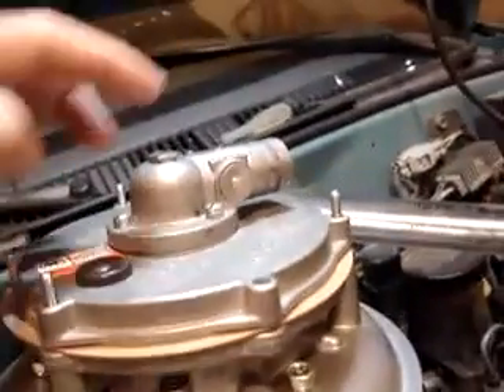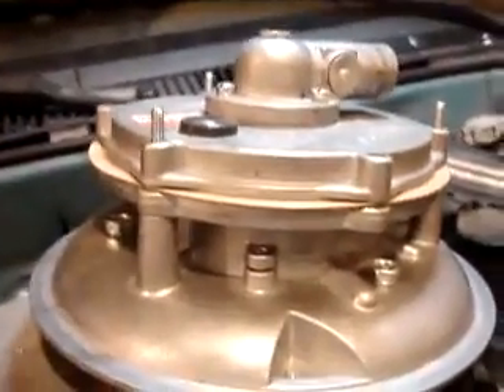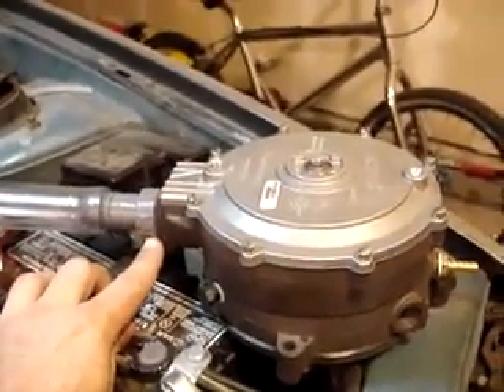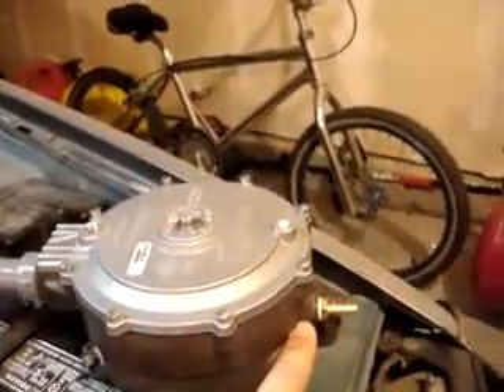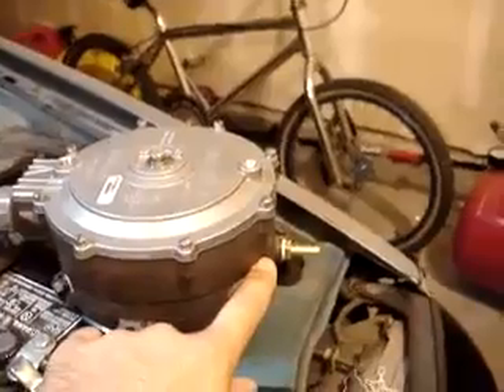Now your car will still run, it just won't drive very well — it would be like having a major choke — and all the vacuum is diverted to this one-inch port. So you've got your air shut off for gasoline, and now you can shut the gasoline off. Because the minute you close this, the vacuum through this hose is going to pull a vacuum on our vacuum regulator, which operates sort of like a scuba regulator. The more you breathe in off of this end, the more it lets in from this end, and this end is pressurized — our system builds up 40 psi on the other side.